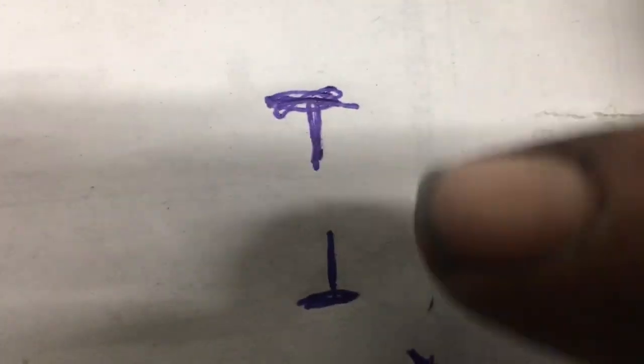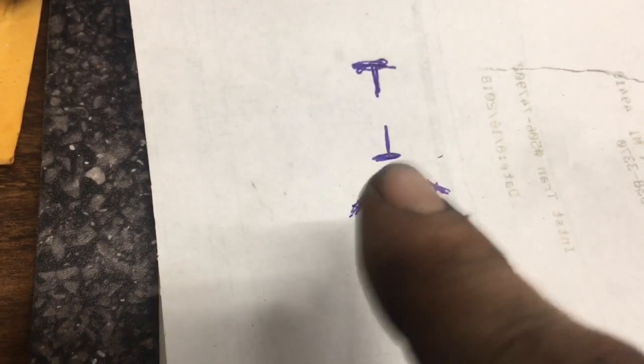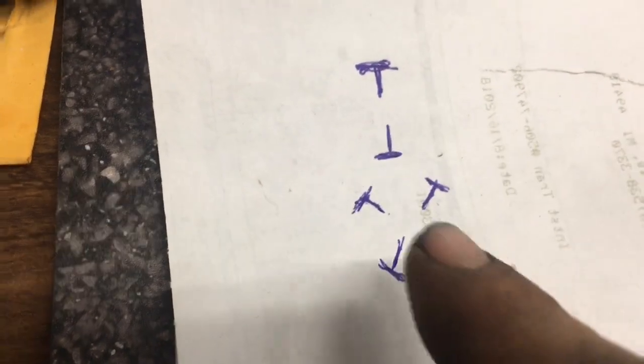What's going to happen with our axle: we have our little hash marks — consider them like little hammers. They're going to be parallel. If it's straight, they're not going to move much. But if the axle's bent, they're going to do a swing back and forth motion. Not quite that much, obviously — that would have to be really bent and you could probably tell just by looking at it. But if they look like they're swinging back and forth, then you've got a bent axle or bent cup.